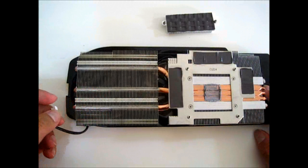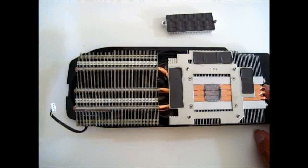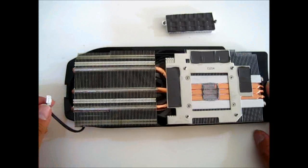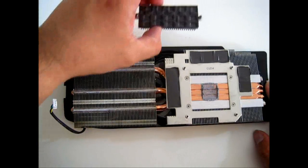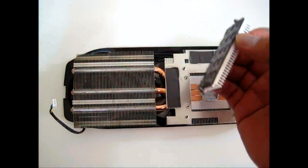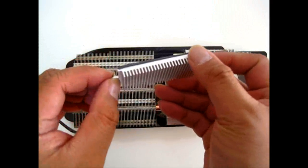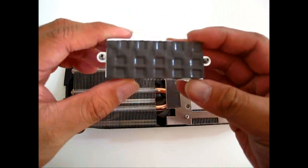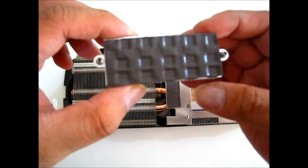You need four-pin PWM to have more accurate steps whenever you're increasing or decreasing fan speeds — it eliminates noise from jarring changes. This is the VRM cooling, which is not exactly part of the Windforce 3x cooling system. In there you can see full five phases and a large thermal pad right across that.